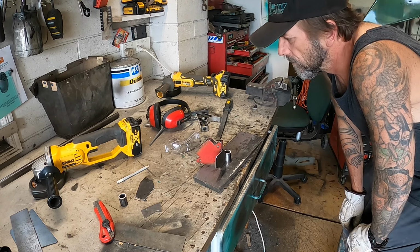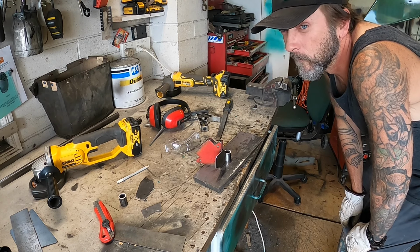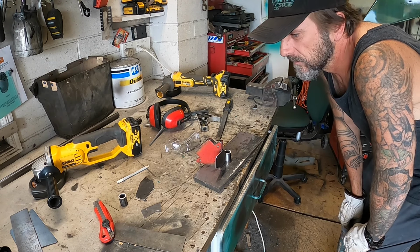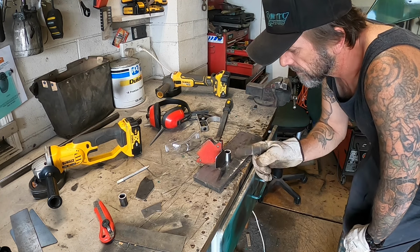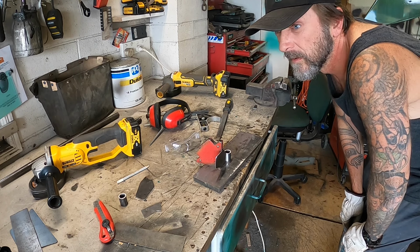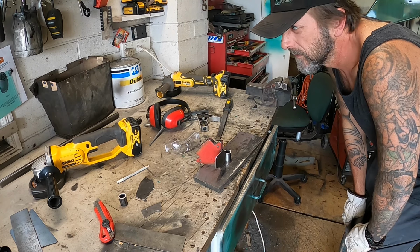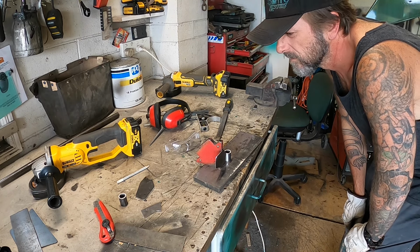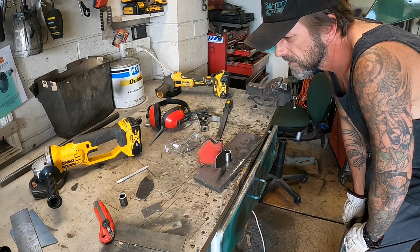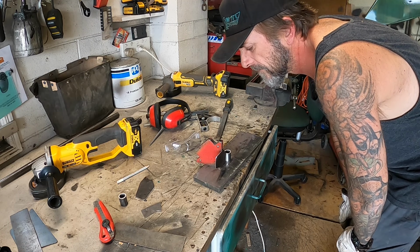Got a plan, I think, for my little doohickeys to go up under the floor to attach the rear part of the cable thing to. So these are my little, I don't know, little eyelet things that I'm making. I'm just gonna weld these onto these little plates, and these little plates will be plug welded onto the underside of the floor. You get where I'm going, hopefully. Wondering whether they need to be plug welded or welded all the way around. Don't know. Now I'm questioning whether they're actually thick enough, whether I should use 3mm rather than this 2mm stuff.